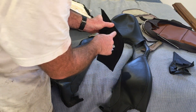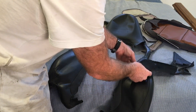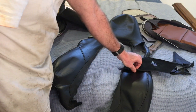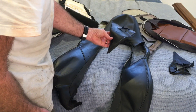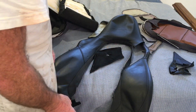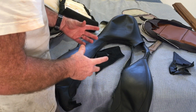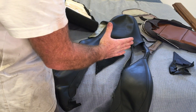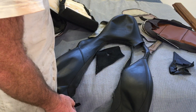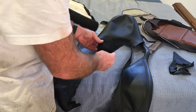Some basic information about how it's all put together: all of the seams on these are eight millimeters. You can see there are notches on these panels that align with notches on the other panels, so when you're sewing them together all you need to do is line those up. I can only assume these are machine cut in the factory so they are extremely accurate. You set up a guide on your machine eight millimeters away. For example the BMW E36 I fully reupholstered took a ten mil seam; these are eight everywhere.